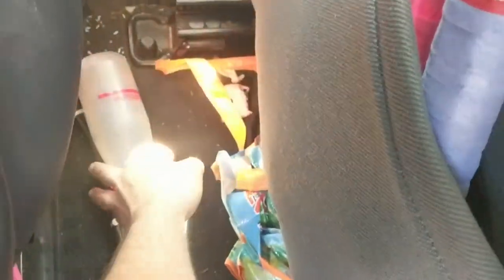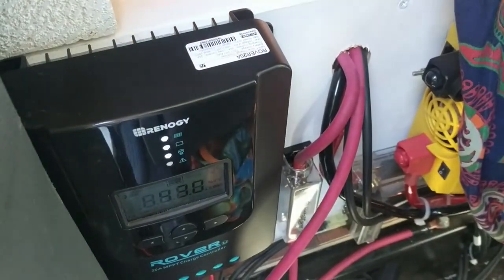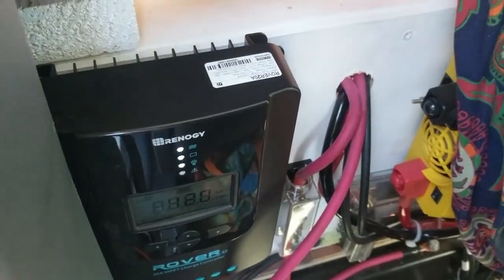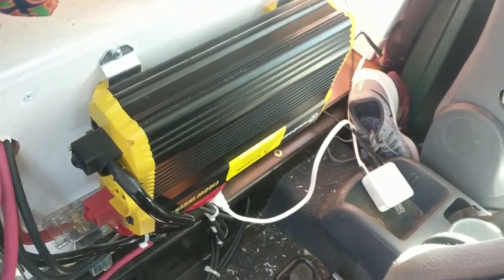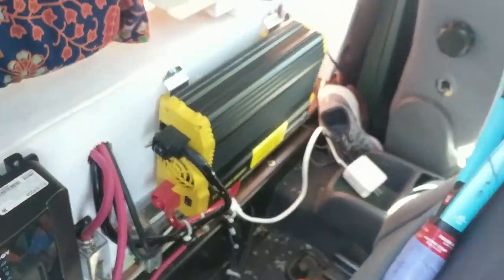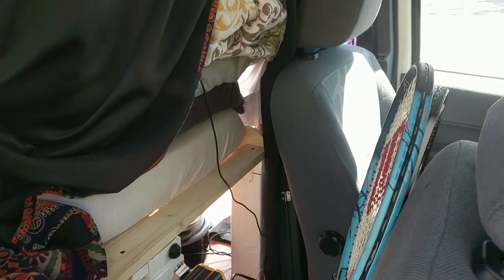Going in behind the passenger seat on the right-hand side — because we're in the US — we've got our tennis rackets back here. Underneath the curtain is some of the solar setup. There's a charge controller: basically the solar panels' voltage is too high to directly charge the batteries, so the controller converts it down to around 13 volts. Under here is the inverter, connected directly to the secondary battery, which gives us AC power and USB charging. It's also hooked up to the alternator, so anytime we drive it charges the battery — if the battery's at 15 percent it's back up after only an hour or two.